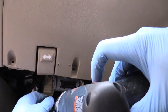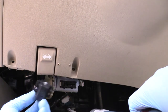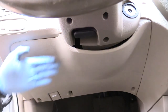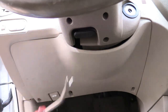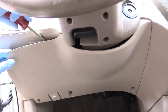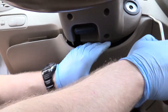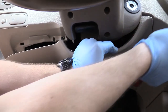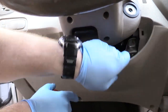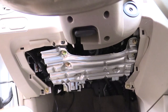I'm going to do my best to film this, but please bear with me as it is pretty awkward to work under a dash with a big camera in your way. The rest of the panel is held in with body clips that need to come basically straight out, and the tool I really like for that is a body clip puller. They're very inexpensive and the maneuver is just basically jimmying your way around the panel. You could also use a standard screwdriver. Be gentle but firm because you don't want to snap anything irreparably. The whole panel comes toward you, and you can just leave it on the ground so you don't have to remove the hood release.